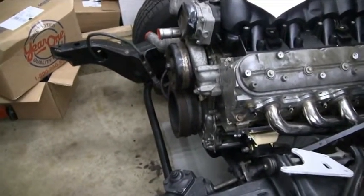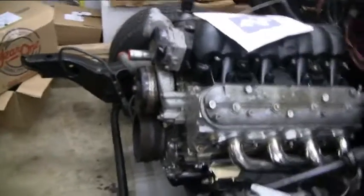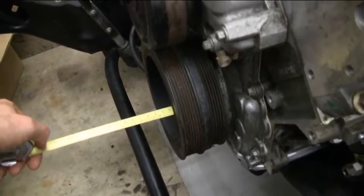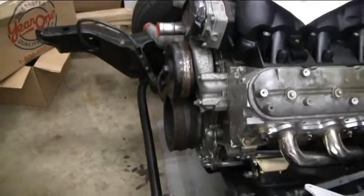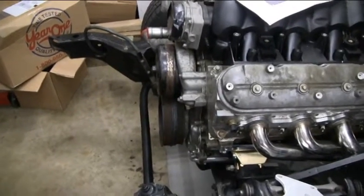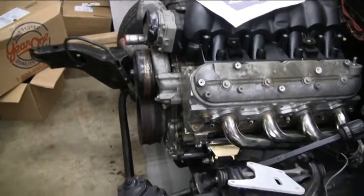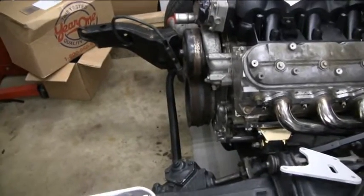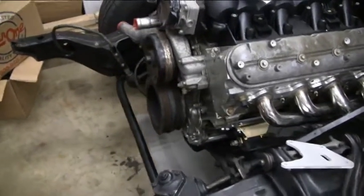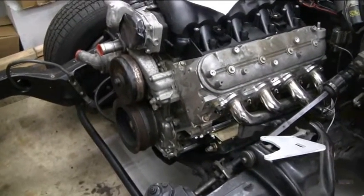We'll play around a little bit with the different accessory brackets, because it was all new to me. There are three different depths of accessory brackets based on the depth of the crank pulley. The tightest one against the block is Corvette, Cadillac, and as I found out, the G8. The next one is the Camaro pulley, and then the truck pulley, which comes out the farthest. The cheapest one to get brackets for, where you can use some existing brackets, is the truck.